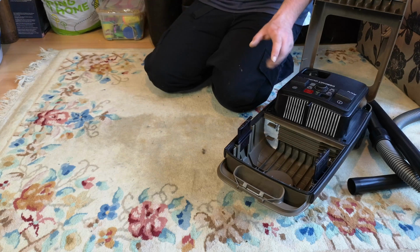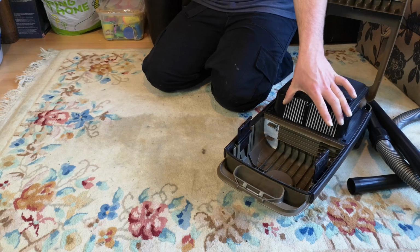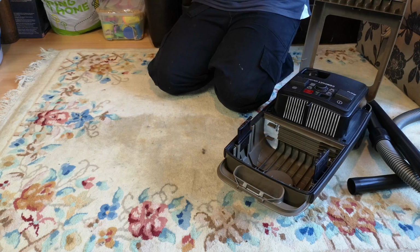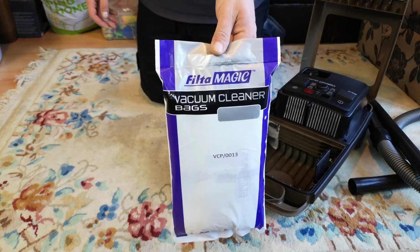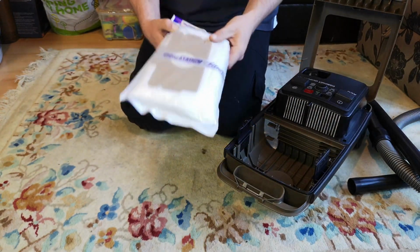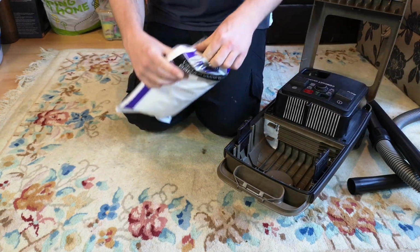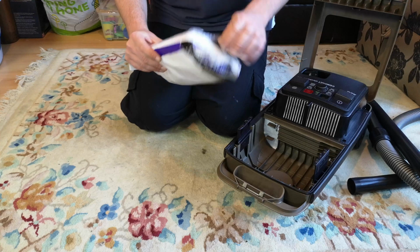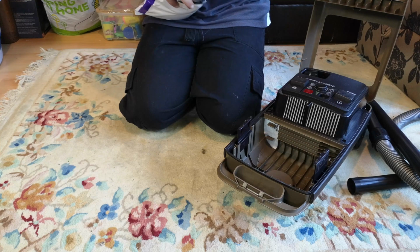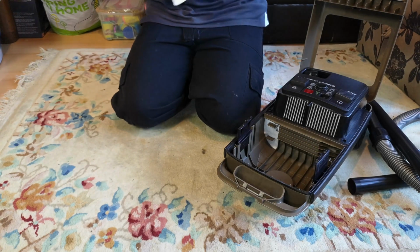Note our nice brand new cut to size Miele filter, and there is an active air exhaust filter hot glued to the back of this grill where there was some coarse foam, to make those filters never get dirty at all. Another Filter Magic product, VCP 0013, not sponsored, although if anybody from Filter Magic is watching, do get in touch. No, eBay and all of the HEPA flow bags for old interesting stuff like this generally seem to come from Filter Magic, so that's good. We only need one, so we'll take those out, and I've now got 5 HEPA flow bags.